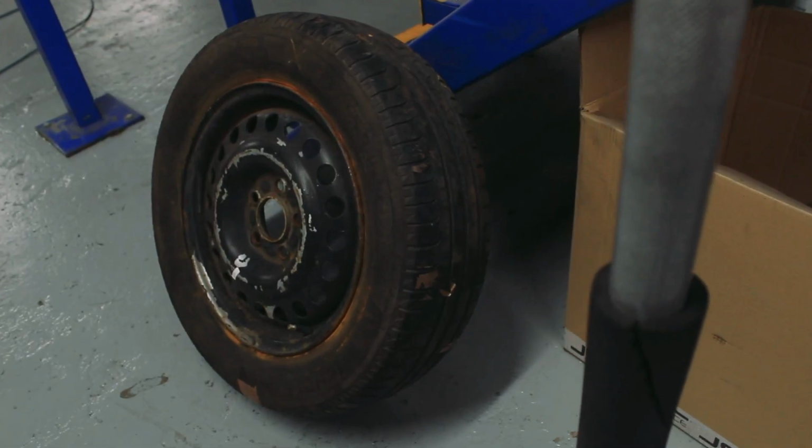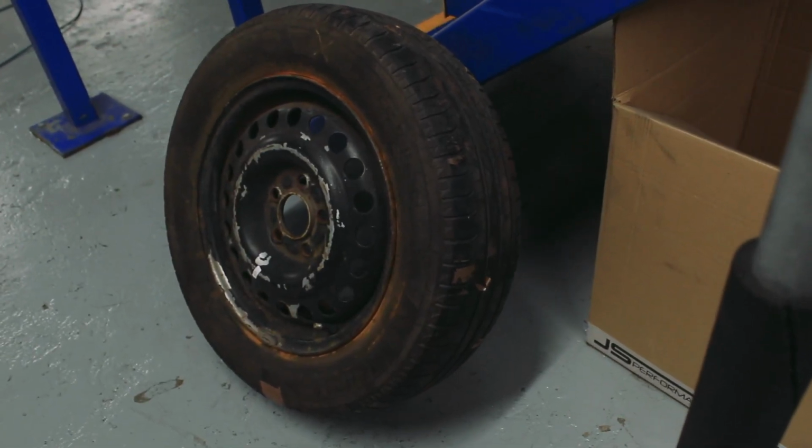Now I can't use the Princess hubcap because that actually is attached to the wheel as the wheel bolts on, and it has four 4x100 PCD bolt holes in it. The Jag is 5x110, so I can't really use the original type hubcap, but what I can do is get a generic BL type chrome hubcap. I'll have to weld some kind of attachments onto the wheel to actually fasten the hubcap on, but we can cover that later.